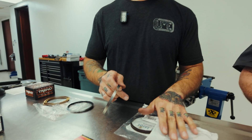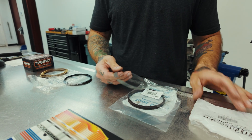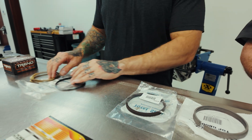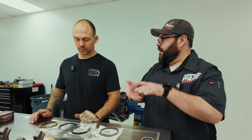We're looking at a 0.9, 0.92 millimeter. We're running the standard steel tops, cast napier second, and then a two millimeter oil ring. That's just the standard stainless plus expander — stainless top, bottom expander.